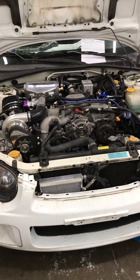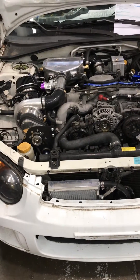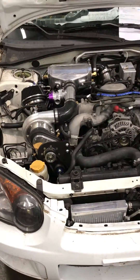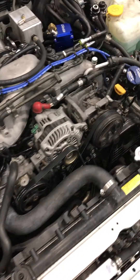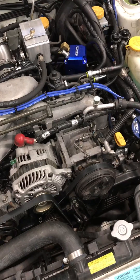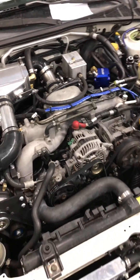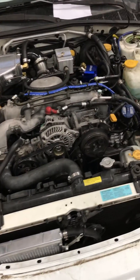Here with Mark Roberts' 2005 2.5 Subaru RS — we did a full custom supercharger build on this. It's got an HMS built motor with very large custom cams; the duration on these cams is over 280, so they're pretty big. It's got big valves, ported heads, all those goodies.